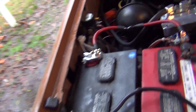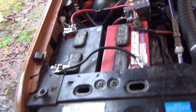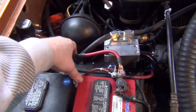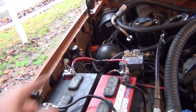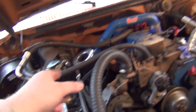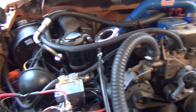Ideally I'd like to have it tied into my switched ground so I can switch it on and off automatically. For right now I'll have to remember to disconnect this when I come back home and tape it off. If it gets really cold — right now I can start with one battery no problem, but if it dips into the mid-20s I'll need a second battery to crank faster, because faster cranking generates more heat to ignite and helps the injection pump build more pressure.